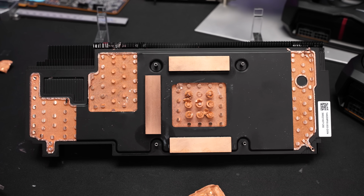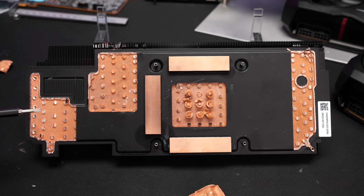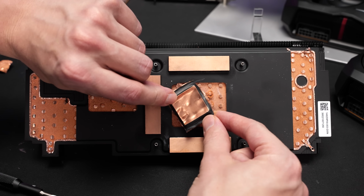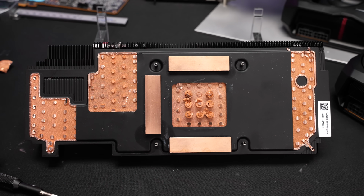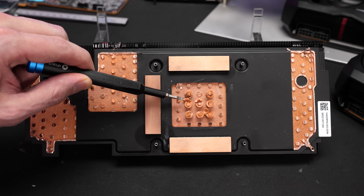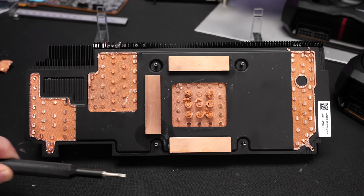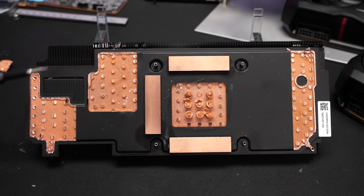And then one more thing I noticed is that apart from the center support rods, all the others, like in this area or here, they don't allow water to flow back on the other side. So that was something I did not expect. Generally speaking, the way it works is that you have water in there and then you have the GPU contact surface area, and whenever this gets warm, the water on this net or mesh will evaporate. And then the vapor will condense on the other side, on this mesh. And then the water would flow back to this area, to the sinter material, and then be transferred back to the GPU contact surface. But I was surprised that it's only the center area that allows the water to flow back, and all the other support rods don't have sinter or a mesh on the side, so they don't allow water to flow back, or maybe just in a very small portion.